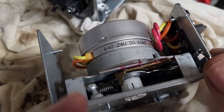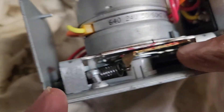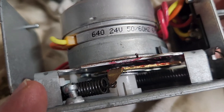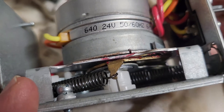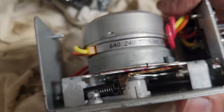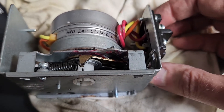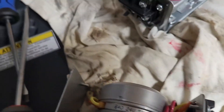In the end what I saw was this white bushing — this white pin — is what the lever and the controlling arm pivot on, and it's worn out. If you watch the gap between this brass plate and the housing while I function this, you can see that gap widens considerably, then it goes back, and it actually rubs on the return, causing too much friction and misalignment. Sometimes when you function this you can feel the gears slip, and it's all because that shaft is worn out and things aren't staying aligned.